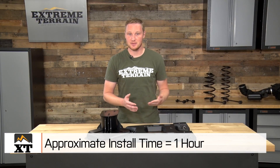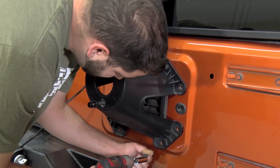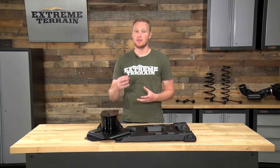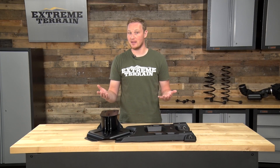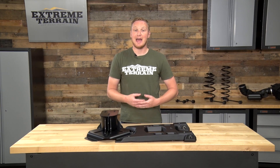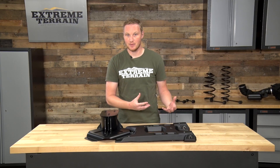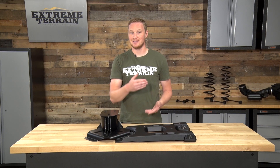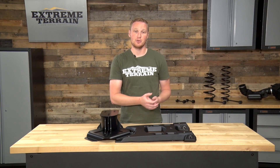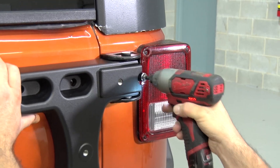This is designed to be completely bolt-on, which makes the installation pretty quick and easy. The first step is to remove your factory spare tire mount and also your factory third brake light all in one piece. You'll be able to take the third brake light assembly out of the mount and hold onto that because you're going to use it later. After that, you'll remove the plastic covers over your factory hinges, and then use some spare blocks of wood or wedges underneath the tailgate between the tailgate and the bumper to hold up the weight of the tailgate. You're going to be removing your factory hinges, and you don't want the tailgate to move around — you want it to stay in the alignment that it is right from the factory. Once the tailgate is supported with those wedges, go ahead and unbolt the factory tailgate hinges, and then bolt on the hinge tire carrier.